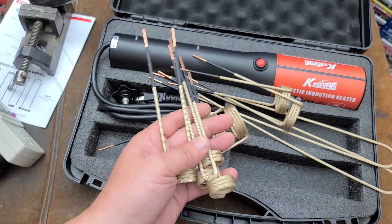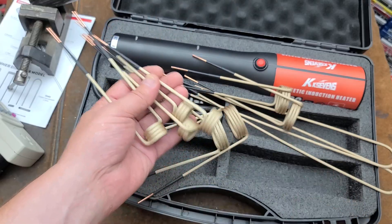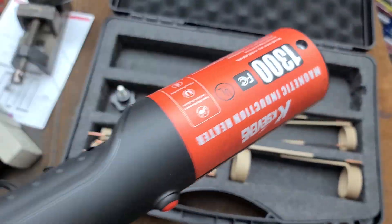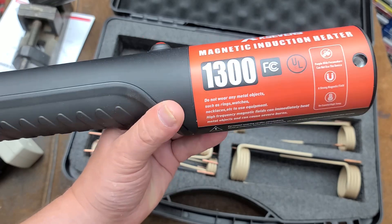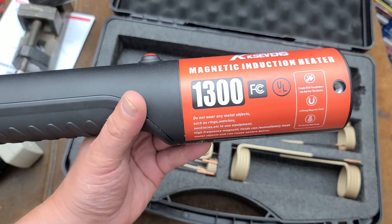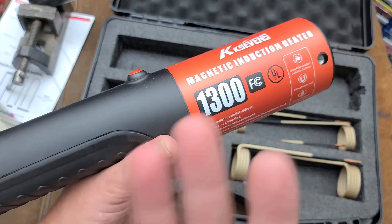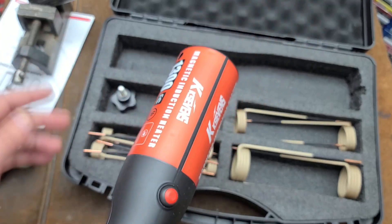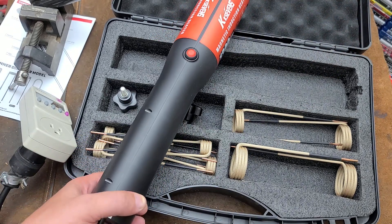That also explains why there are a lot of complaints about them — maybe having a little bit of fundamental understanding of transformers and how they work, because that's essentially what this is. A lot of these have a 1,300-watt rating, but there are either two different versions — ones around 750 watts and ones around 1,300 watts — or it's just a fundamental translation error. Most of the world is 200 or 220 volts. This is rated at 6.5 amps. Most of the world is 220 volts, so they say it must be 1,300 watts. But in North America at 120 volts, this is actually going to output around 1 horsepower, or 750 watts.